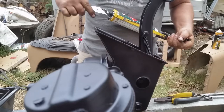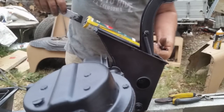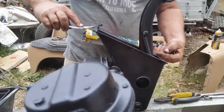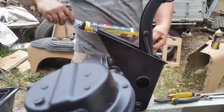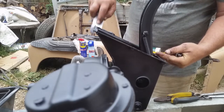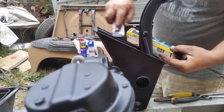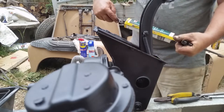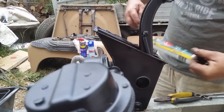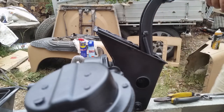This is the brake pedal box and I'm putting what we used to call dum-dum. Dum-dum is a thick pasty non-hardening bitumen kind of product that used to get used in car assembly when gaps and tolerances were a little bit bigger than they are now. It's hard to find — you go into a shop now and ask for dum-dum and they really don't know what you're talking about. I've had this tube for many many years and unlike most other things in tubes it doesn't go off. So I'm putting that all around anywhere where dust could creep into the passenger compartment.